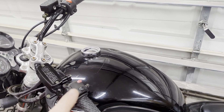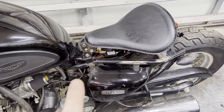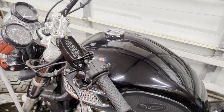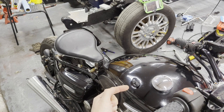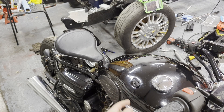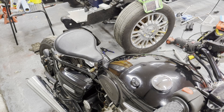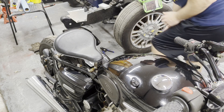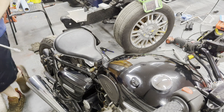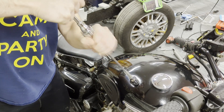I'm going to do a little more work on the dent just off camera, continuing with the paintless dent repair. From here it's a lot of just buttoning up loose ends — we've got to paint anything we've ground down on the frame as well as the seat pan we've created, and then bleed the clutch and brakes. We still have our little piece glued down and we're using the slide hammer. The dent is definitely getting smaller but it's a long process — it's a pretty bad crease, so we may never get it perfect, but we're going to keep working on it.